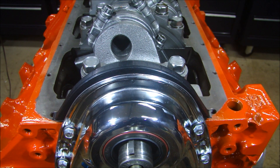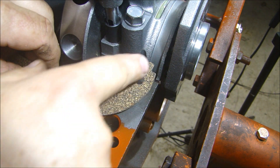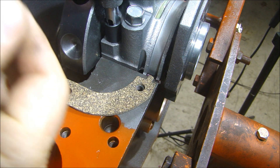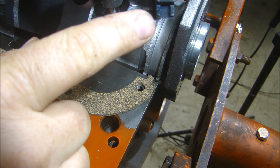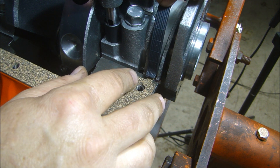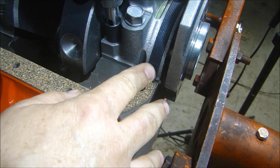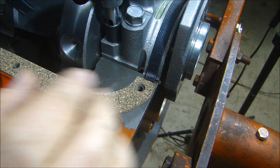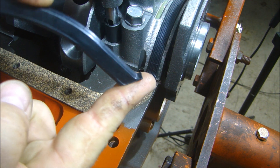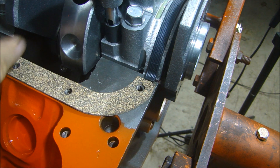Now let's take a quick look at the back side. The rear gasket fits along the rear main cap here. You can see that on the pan gasket there's this little tab. That little tab has got to line up with the center of that slot in the rear main cap. Because the seal that goes in there — this tab has got a notch in there, and that notch in the gasket for the cap has got to line up with the tab on the cork gasket going around. So that's got to line up just like that on both sides. Unlike the front one, the front gasket does not have a slot where this fits — this foot just sits on top of the gasket, and you use a lot of sealer to make sure that seals. So we'll seal inside this corner on the front and the back.